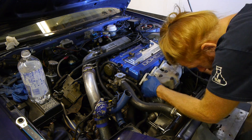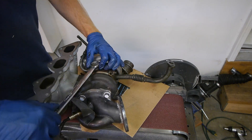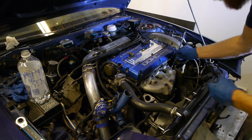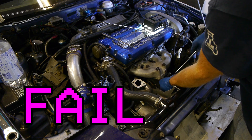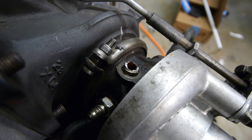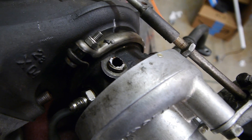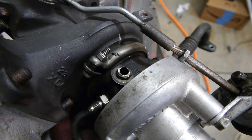And then I forgot to put the rear waterline on, so I had to take the whole assembly off once again. Double the fun! Then, to add even more fun, when I was hooking up the front waterline, I just grabbed my biggest 22mm wrench and started honking the bolt down. And guess what that leads to? Oh, f**k. Yeah, this thing only needs about 30 foot-pounds of torque. This is why we pay attention to torque specs - so you don't do this to your water bolt. That sucks. Luckily I have another water bolt lying around somewhere, so I'm just going to have to go find that and dig it out. But I have to get this out of there first. Good job, Hulk. You really showed that bolt to his boss.